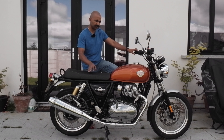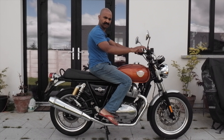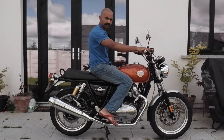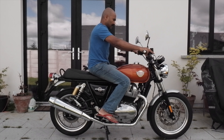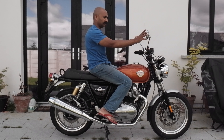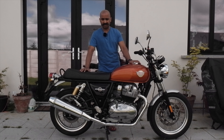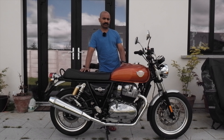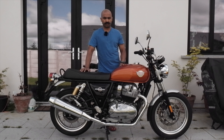That's all done. As you can see, I've got a bit of a rise — that's 30mm. It's not much but it makes a difference to get that ergonomic position right, and especially when I'm standing up it gives me that better leverage. I've tilted the handlebar a little bit forward as well so that it gives me that extra stance. This looks brilliant, I like it. If you like this video, please hit the like button and leave me a comment if you want to know anything more, and subscribe to this channel for more awesome content. Thank you very much. Stay safe on the road and I will see you in the next one. Good luck, bye bye.